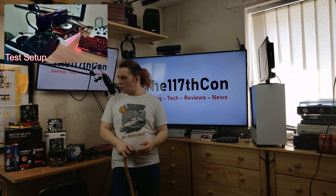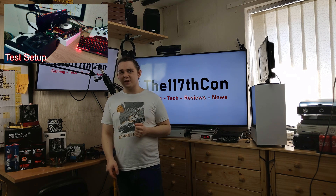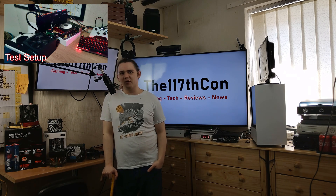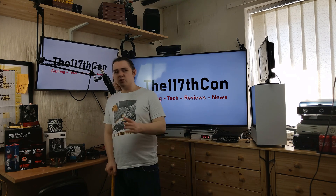But not something so big like a Hyper 212 EVO that it just won't make a difference anyway. The rest of the system includes a GTX 1080, 16GB of HyperX Savage DDR3 memory at 1600MHz — it does actually go up to 1866, but due to limitations on H-boards it's only clocked at 1600 with really tight timings instead.